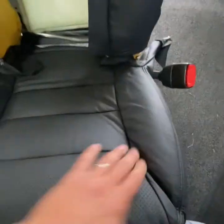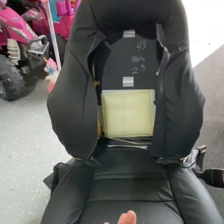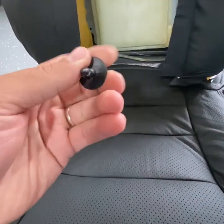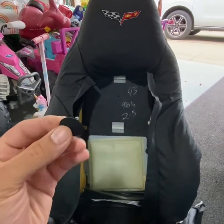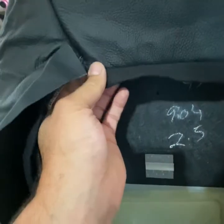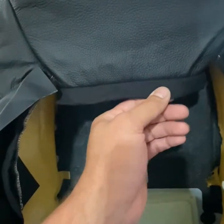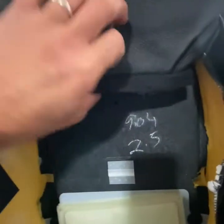Your upright just literally drapes over the back of the seat - the cushion is the same way. The first thing we're going to do is take the OEM clips - if they're in bad shape you can always go to any auto parts store and replace them. We're going to put the four push pins or push clips back into the headrest area. This is a stitched-in lip that they leave for these aftermarket seat skins - on the original OEM seat it's the same thing, but with a plastic piece to give better contact when you snap it in.